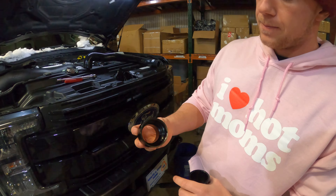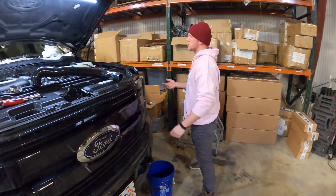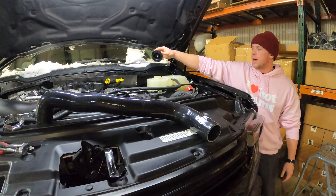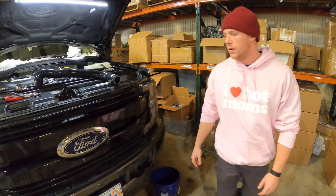You have two hose clamps and your billet ends. The o-ring is already installed in this one. First thing — you don't want the truck super hot. Release any coolant pressure you've got going on, especially the hotter it is. Take the cap off and let it settle so you don't have any built-up pressure. Drain it — I'd recommend about two to three gallons, just so when you go to pull it off you're not throwing coolant everywhere.